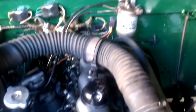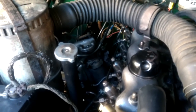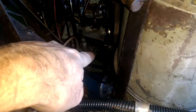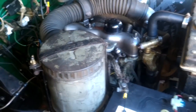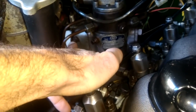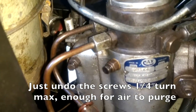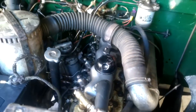All in position now — the sedimentor and a new filter. The last thing to do was to bleed the lines so there's no air in the diesel lines. The way to do that is to use the lift pump — that's the one down there where my finger's pointing, there's a little lever in there. You just pump that lever to feed fuel through the lines, and while you're pumping you undo that screw and that one there, crack them open and let it bleed until no more air comes out, then do the same for the other one. Then you should be right to start it.